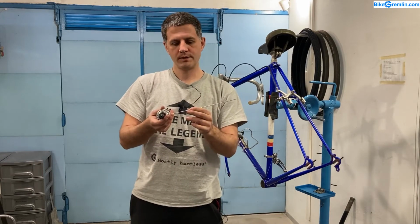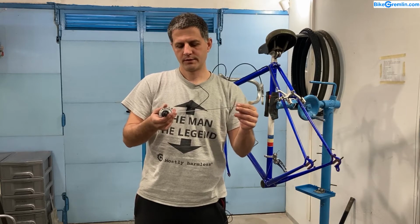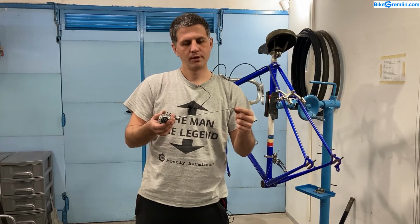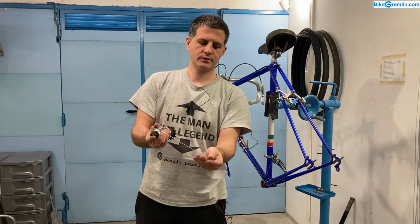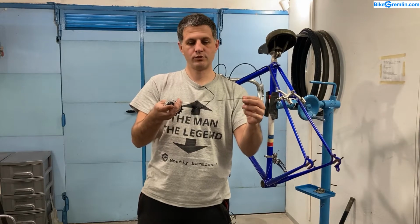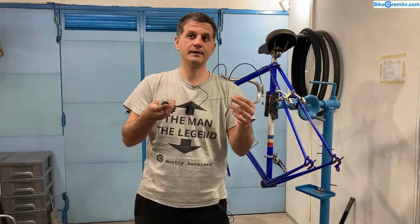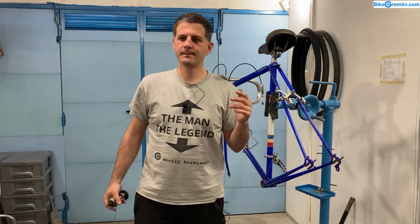So the thinned down midsection acts as sort of a shock absorber that reduces some load from the critical points of a spoke that are near the elbow and where the nipple threads are. So it helps reduce load on those parts by elongating a bit more easily, acting as a sort of a spring effectively. There are also spokes that are marketed as triple butted.